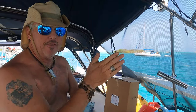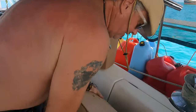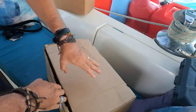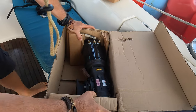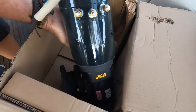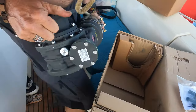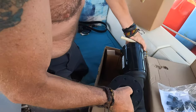All right, now for the fun part: unboxing. We got the two boxes. This is the v5 24 volt motor gearbox, and you can see right here it is almost an exact direct replacement for the one that we just removed. The motor looks almost the same size and we got the plug covers for the wiring, and I think we're just about the same as what we just took out, so that's cool.